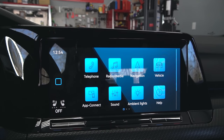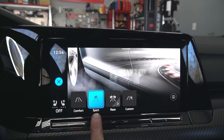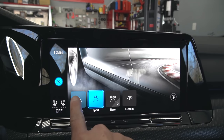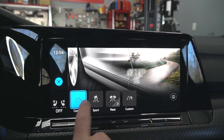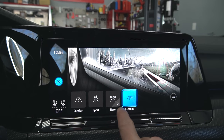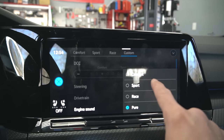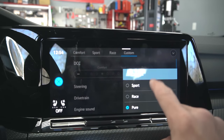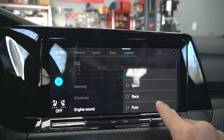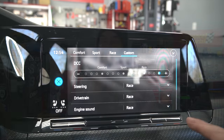Now we can test it to see if it worked — we'll go ahead and start the car. I can already tell you it's not on, but to prove that: one thing I don't like about this car is it defaults to sport mode. But when we go from comfort to sport, we should hear a change in the exhaust. So we go to custom — that's engine sound pure — comfort, race. We're hearing the flaps in the exhaust go, not the sound actor.